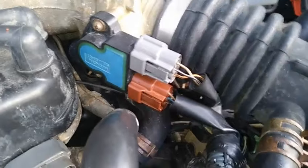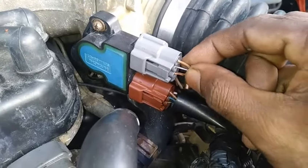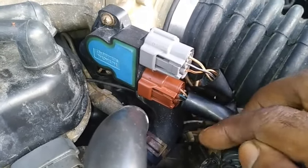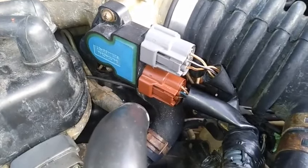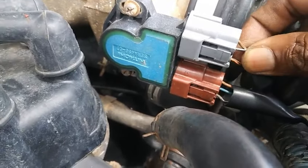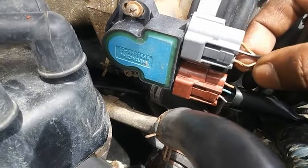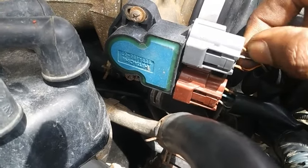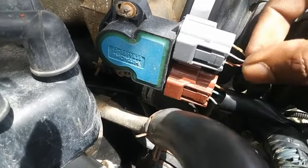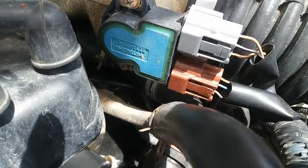What needs to be understood here is that the top plug, which is silver gray, is not used for ECM communication. Instead, the brown plug with the three wires is directly for ECM throttle idle control. The orange wire with the black stripe on pin number six is the open throttle position for the sensor, and the other two wires — the black wire with the pink stripe and the brown wire with the white stripe — are on the closed throttle position circuit.